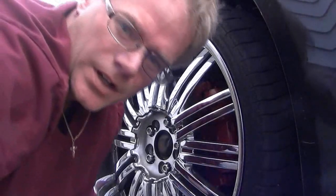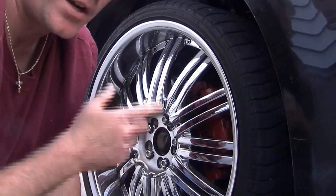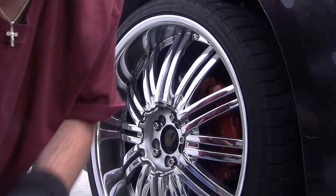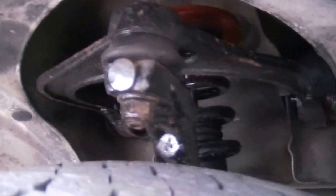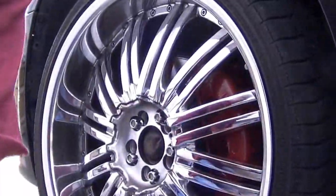So here we are now. We're going to carry on with the 2005 Dodge Magnum. We're going to replace the upper control arm. I'm going to show you exactly what is wrong with this one before we replace it, so you can actually get a glimpse of what is going on here. We have a lot of clunk in there. We know that that ball joint is completely worn and we are going to replace that.